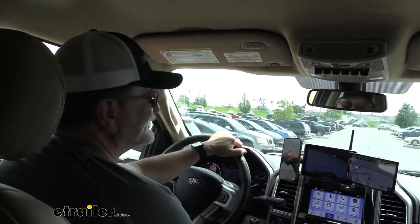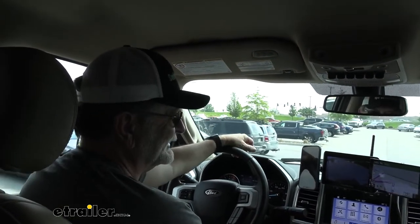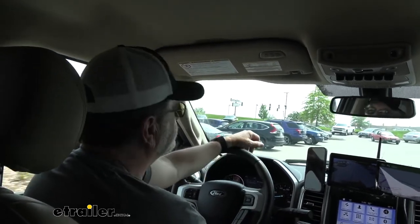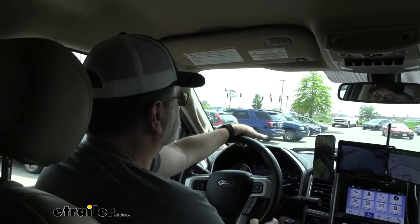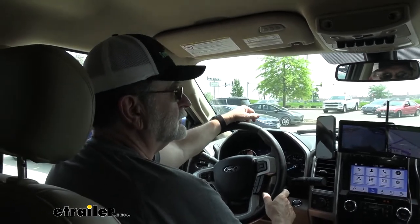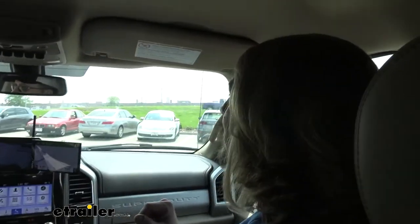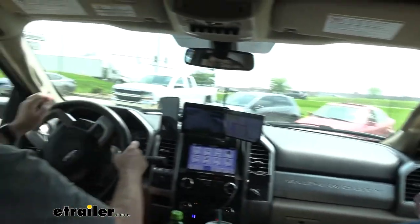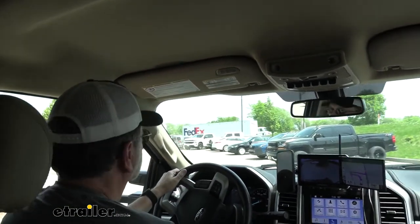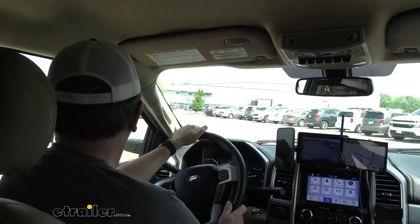It's almost like it's not there. That's what we like to hear. There are a lot of vehicles where your factory controller has an option to switch it over to electric over hydraulic - we already made that adjustment. If you don't make that change, it may not operate exactly as you expect it to. If you're testing yours out at home and something seems off, double check your vehicle's factory controller to make sure you've switched it over to electric over hydraulic so the system knows what equipment you're working with. It was easy on the floor to make that switch.